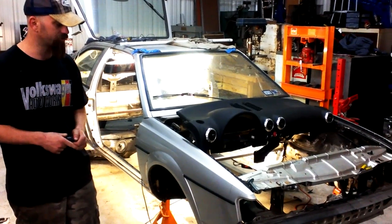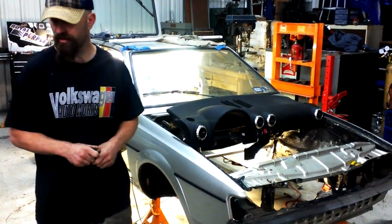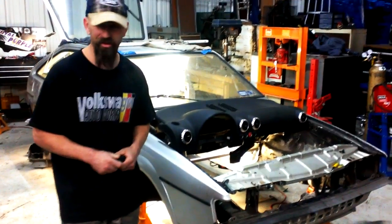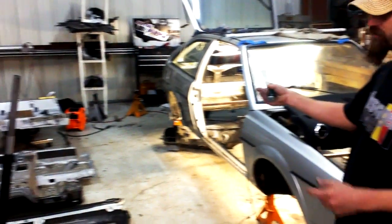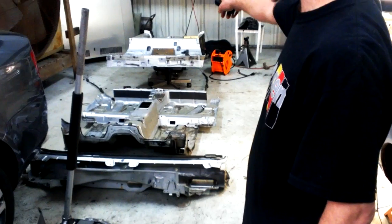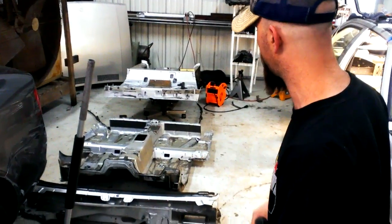We got a 2002 Audi TT, and it's the all-wheel drive. We cut the car to pieces, basically, and this is what was left. We took the main floor pan and the trunk floor pan and segmented them. We drilled all the holes and all the spot welds out and delaminated it the correct way.